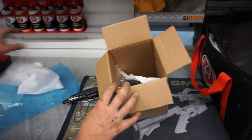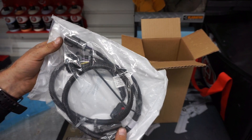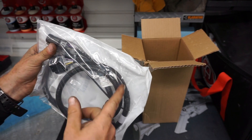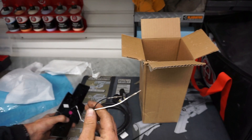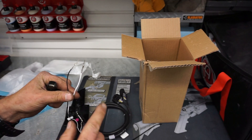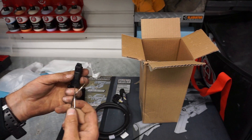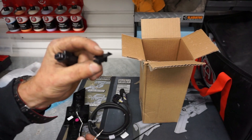It comes with everything you need included in the kit. The corresponding wire harness is included — you simply unplug the headlight plug, plug this in, rob some power, and then plug it into the illuminated bowtie. The bowtie itself does not have a harness on it because you need to drill a hole through the grill, feed the wires through, attach the corresponding wire harness to the plugs, and they even provide a locking clip so it won't come apart.